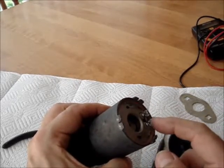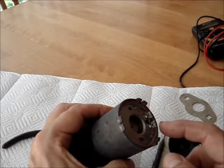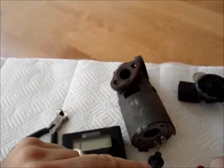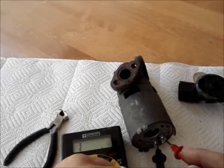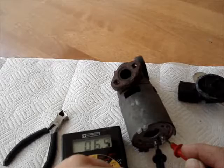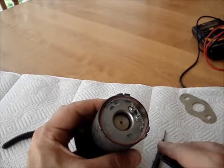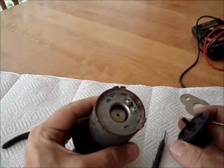The other thing I did is, these are the connectors here to pins 4 and 5. I took my battery charger, 12 volts, and put 12 volts on here, and sure enough, the solenoid sucked in. Here's the resistance check to verify the solenoid — pins 4 and 5, and I get about 6.4 to 6.5 ohms. That's the inside of the EGR valve — there's the solenoid and the motion, how that works.